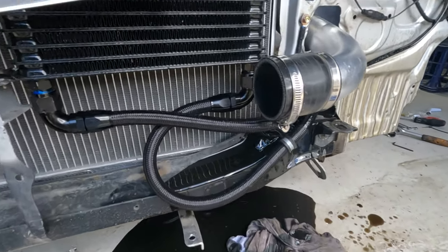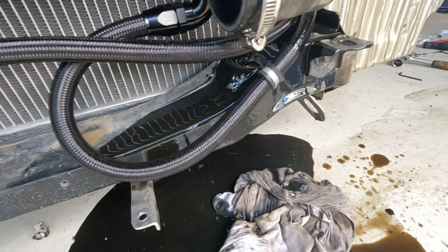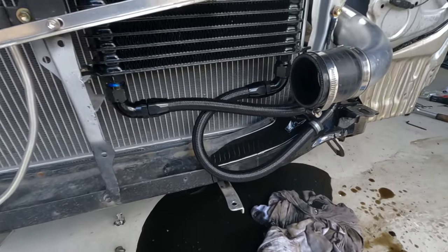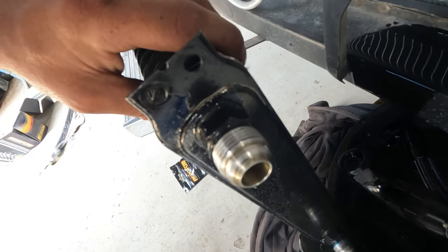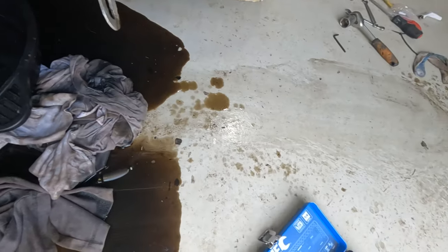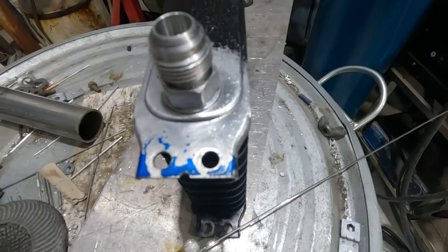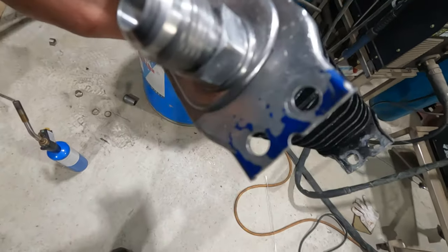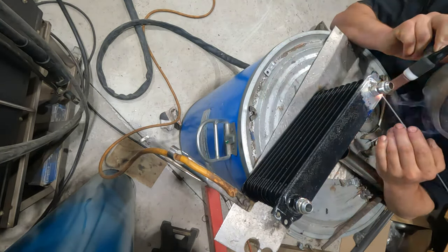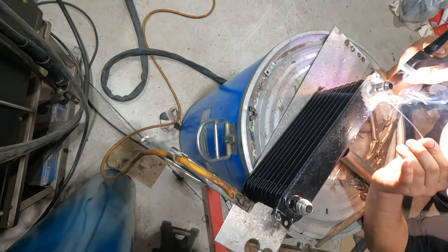Put the oil filter back on — and it's less than ideal. All the fittings are tight but this one's not leaking — it's just spewing out of there. That's half the oil! Everything comes again. We'll have to inspect why it's leaking there. That's the culprit — a little crack. It'll lose its oil real quick. Look at the mess — it's spattered all the way over there. But it's time for an oil change. Definitely see the crack there; there's a little crack at the bottom of the fitting too.